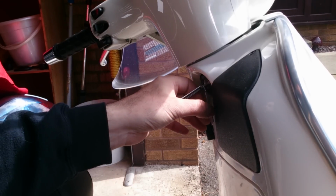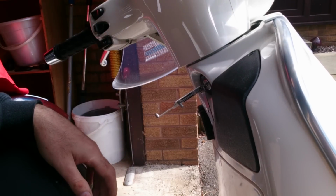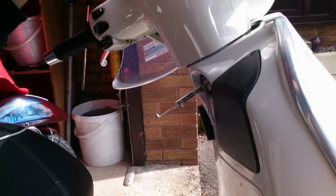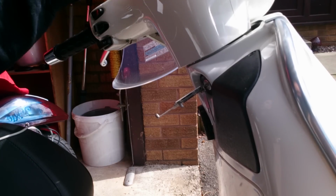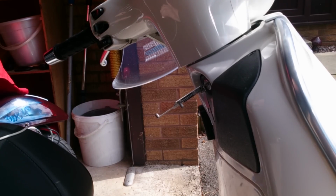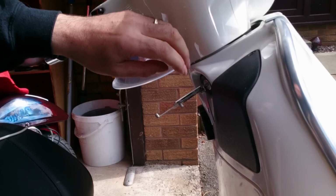My ignition has just turned on, and obviously there's no immobiliser chip here, so if I press the start button with a brake, that's your immobiliser in action. The immobiliser light on the dashboard is solid, the lights are all turned on. I've now picked that open. Now what I'll try and do, you won't be able to see this I'm afraid, I can't give all my secrets away, is decode the lock off the pick. Then we're going to go into the van and cut a key. And I'm actually going to copy the red key today and see if that works.